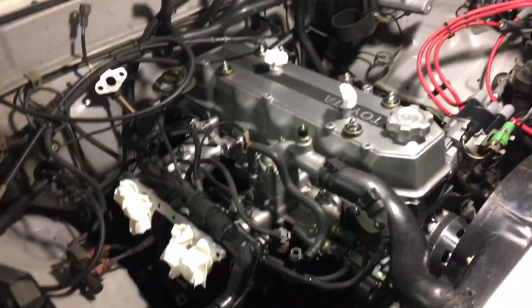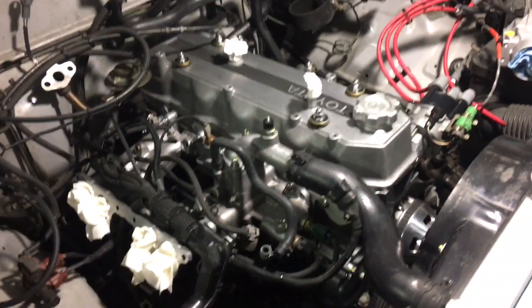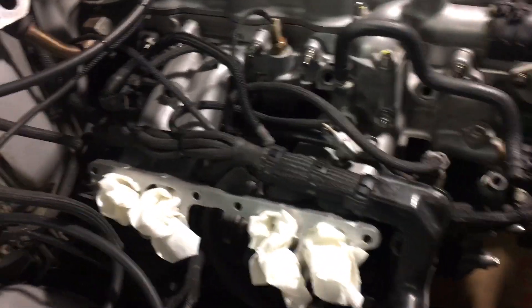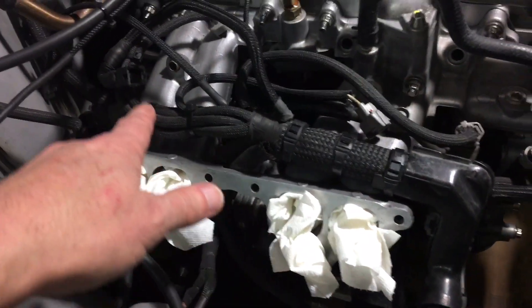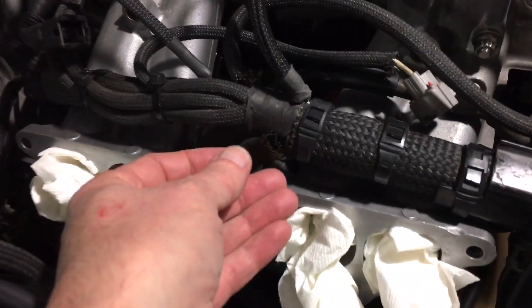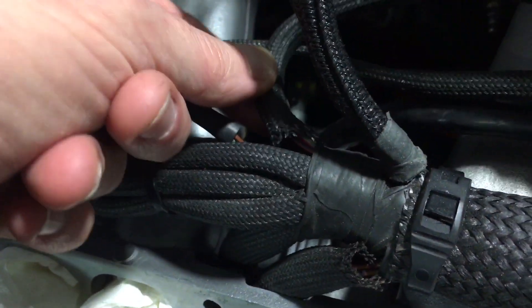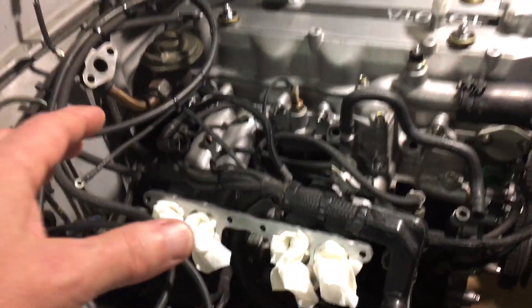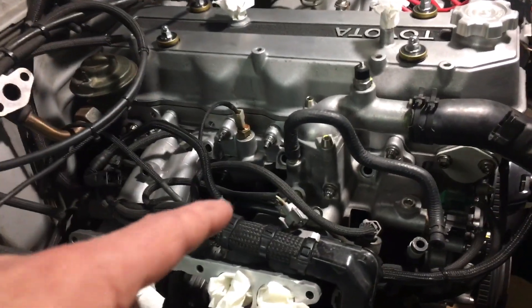Getting down to the nitty-gritty on the 22RE - put the motor back together. Just showing a video of where I'm at for anyone curious about what I'm working on. I rebuilt and redid the wiring harness on the truck - lots of modifications. Some insulation has come free in a couple of areas, so I'm going to wrap it again with some self-vulcanizing tape. I've got the intake runners on and the cross pipes around the back.